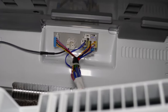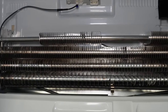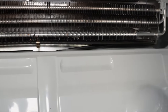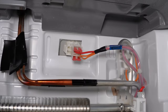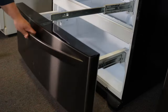Just like the refrigerator cabinet, remove the wires behind the cover to access everything, and the entire evaporator assembly will be available for viewing. The diagnosis is identical to the refrigerator cabinet: is there heavy frost, light frost, or a large ball of ice in only one area? How do the sensors test out? Is the fan circulating air properly? Here's the sensor resistance chart again — note that it is different from the fresh food cabinet values, but you check it the same way with a multimeter.